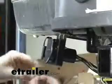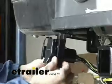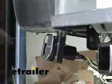For the 7-to-4-pole adapter that we need here — if you don't have one pre-existing, you need to go ahead and mount a 4-pole connector on the vehicle. This particular one has a factory 4-pole already on it, so we're going to plug directly into there.